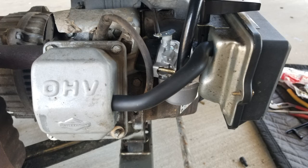Everything is put back together to run on gas. You can see the brand new carburetor, the linkage rods coming off the top, the air cleaner bolted back on, and the choke control back on. The brand new crankcase breather tube is back in there too. I did not get a video of cranking it up on gas - I cannot believe I forgot to do that. But it cranked up literally on the second pull after six to eight years of not running.